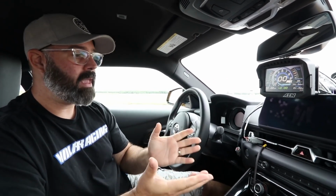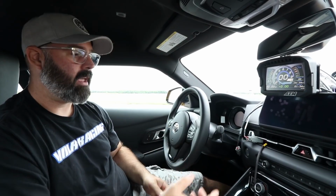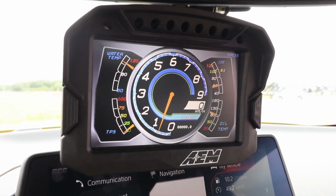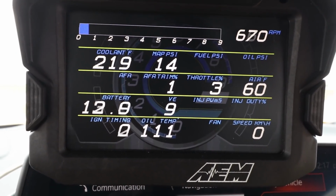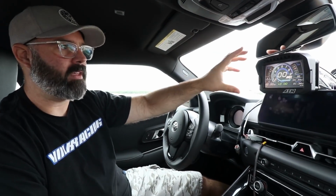They've also made it relatively simple to interface with your car. So in a 2008 or newer car like the Supra is, they offer it with an adapter harness which plugs into your OBD2 port, and all your OBD2 data therefore goes to the dash automatically. And the dash will make perfect sense of all the CAN data off of any 2008 or newer car. And it's also designed to work perfectly with any CAN data off of AEMnet's own system. So if you have an Infinity ECU or, say, an EMS-2 in your car, this will read that CAN data perfectly as well. And they have a huge list of aftermarket ECUs that this dash also supports. That's sort of a primer on the power of this dash itself.